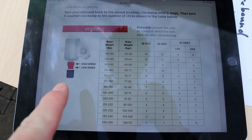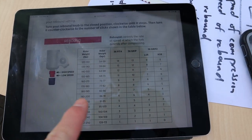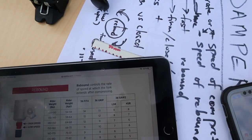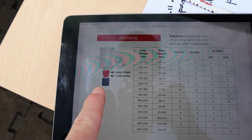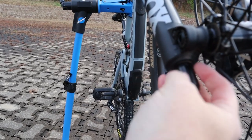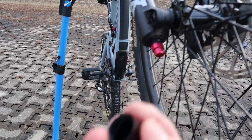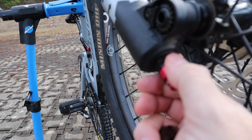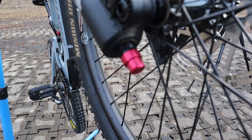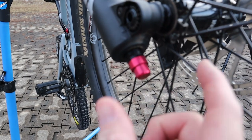I have a damper with both low speed and high speed rebound. I'll set the high speed rebound to whatever Fox recommends — somewhere around 3 clicks — and focus on low speed today. I'll turn the high speed rebound clockwise until closed, then back it off 3 clicks: one, two, three. That's the recommended Fox manual setting. Once we get out on the trail for part three, we'll set all the high speed controls.